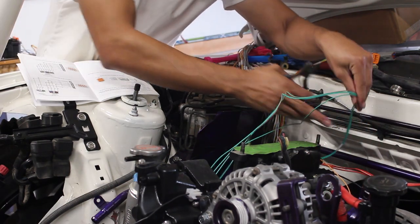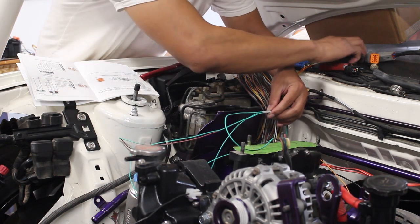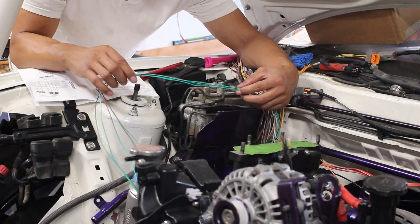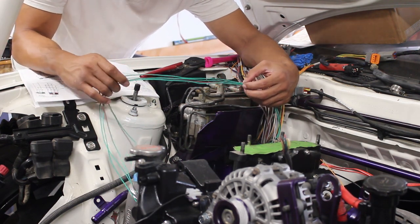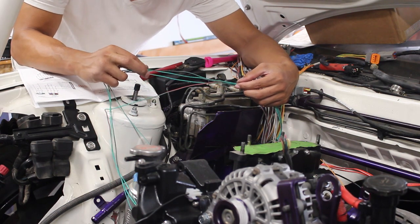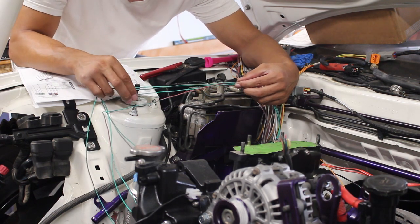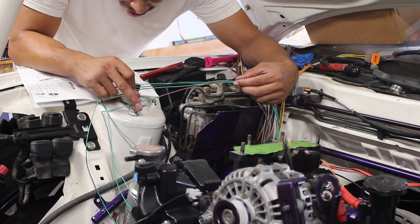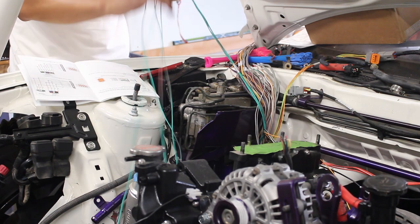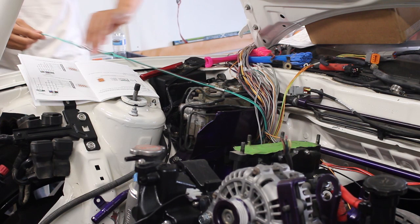These show that they are for the stepper DPO. In the Haltech wiring for the oil metering pump, it says we need a solid green, green and black, green and gray, and green and red. That's these four — let's wire these.